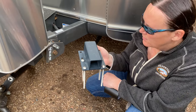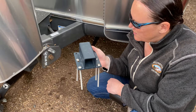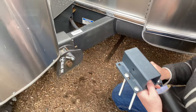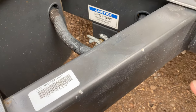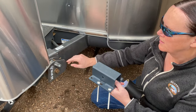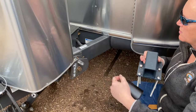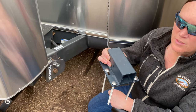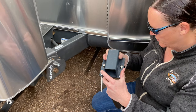Fred and I discovered that this mount will also mount onto a frame rail, which I'm delighted about because we don't need any special tricks. But in our dry-mocking, just having this up briefly, we've already nicked the paint — which really annoys me about frame-rail-mounted stuff like weight distribution hitches. So what I'm going to do is put a little strip of flex seal right around the rail. Obviously this wouldn't work on a load-bearing system, but this isn't load-bearing at all — it just prevents the mast from moving back and forth. I'm going to wrap the frame rail in a little flex seal and go from there.